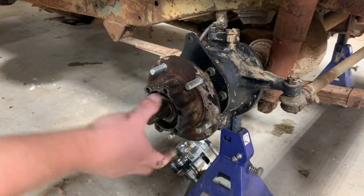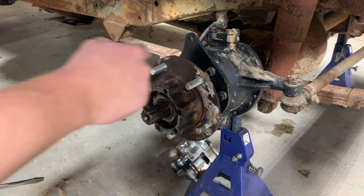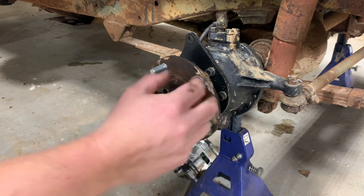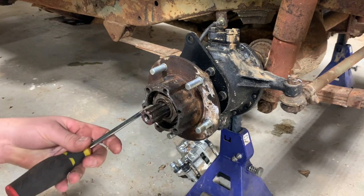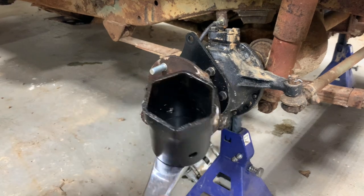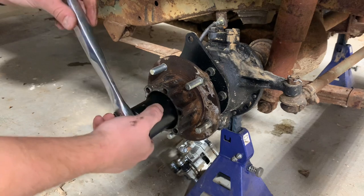Now you've got your hub, or your drive flange, off, either one. You're gonna have a nut and washer. So there's a little piece on this first washer folded over to keep this nut from turning. Take a little screwdriver or a chisel or something, and you're gonna knock that flat back. And then take the appropriate socket. I'll have this link down in the description. Go ahead and knock that thing loose.